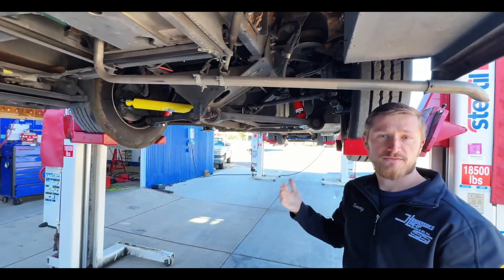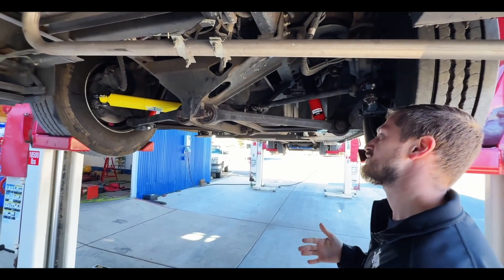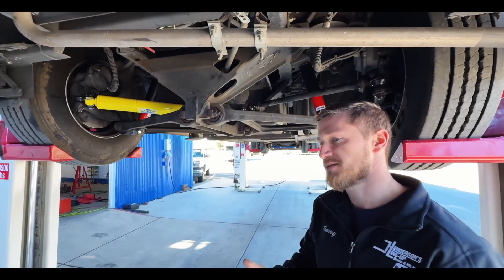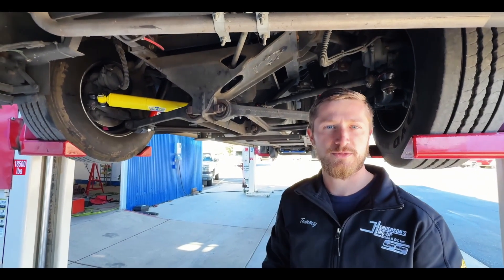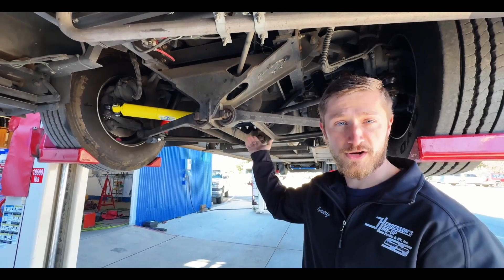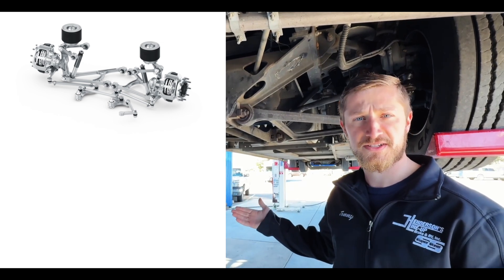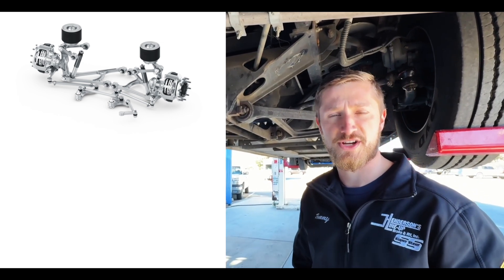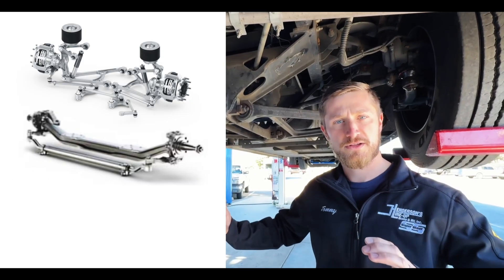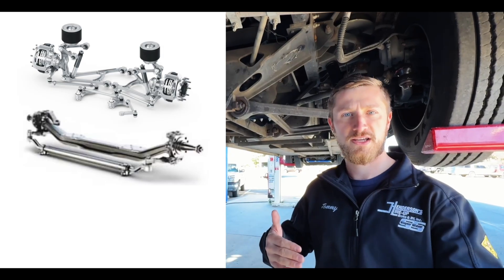Generally these are a very good front suspension. We're typically not seeing a lot of play or issues in them — not as much as you might see on some of the straight axle coaches. It is important to note that the Freightliner XC chassis does come with several different front suspension options. The larger ones were made with the ZF independent front suspension, and the ZF front suspension is still being used on the Freightliner XC chassis. There's also your traditional cast I-beam solid front axle suspension.